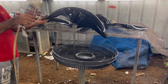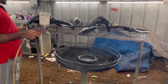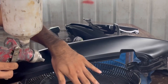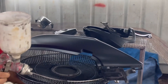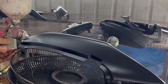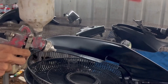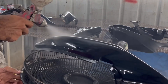That process is not always applicable for every type of color — it can vary from one color to another. If you are using a light color or something related to a gray or silver shade, sanding it down with a 2000 grit sandpaper at that point would definitely bring some fine scratches under your clear coat. Anyway, these are just the basic ideas of getting your bike or car painted in metallics.